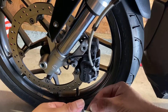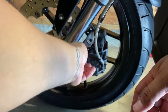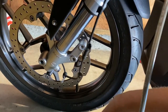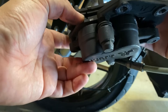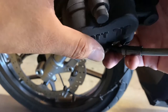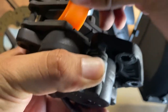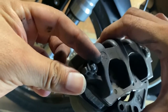We removed it. We're going to want to put some new thread locker on after — just scrub the threads with a little wire brush right now. Take off the next bolt and just slide the caliper out carefully and gently. There we go. I'm going to take it apart the same way and push this caliper back in — I'll actually do it with the old brake pads. Squeeze down gently and evenly because there are two pistons, one on each side. Keep going until you can no longer go any further.